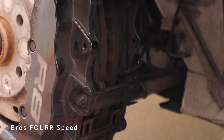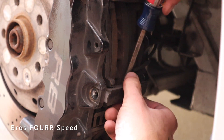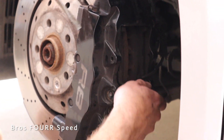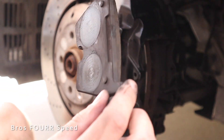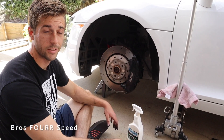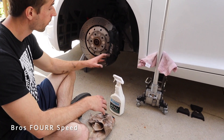There's also a bar separating the upper pads and the lower pads with an odd socket to it. With those two bolts removed I can pop out this bar. It's pretty interesting — we've actually never dealt with an eight-piston caliper before. Once I get that out we have the four brake pads, with one more bolt to get to underneath. We lay the pads on the ground so we know exactly where they go back in. The rear caliper is pretty much the same as the front, just not quite as big with fewer pads.